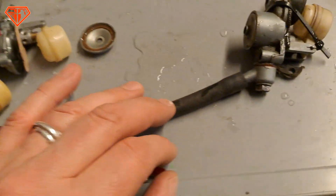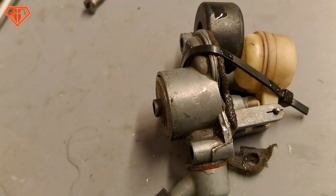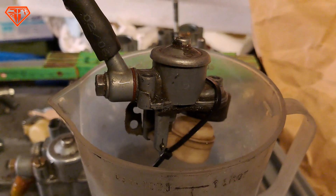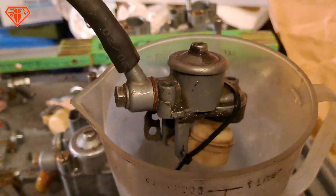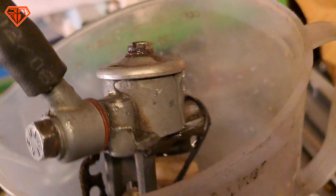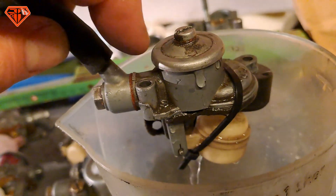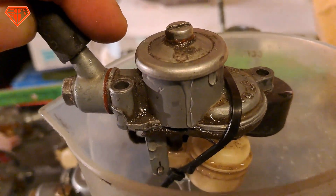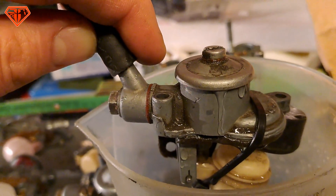Cheers mates. I'm just doing flow measurement this time with water. What I can show you now is the issue with this very old classic fuel chamber cover — the thread is mostly too high. I'm now opening the fuel tab and look at this: the round filter chamber cover is not tight, it is leaking due to the thread being too high. So many Vespa mates all around the world are annoyed by this problem. That's the warm start problem.